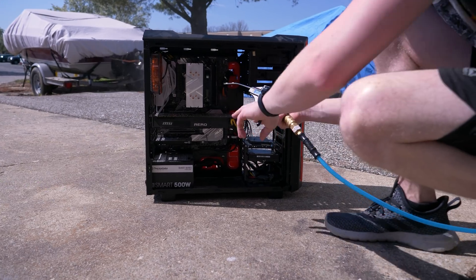Professional building. This is OG Matt building right here. We'll take everything out and make sure we put it back in well. We're going to replace these PCI covers and reapply thermal paste with some new Arctic thermal paste, because it is actually recommended to replace thermal paste — especially the cheaper stuff — every few years, because that dries out and loses a lot of its conductivity properties.